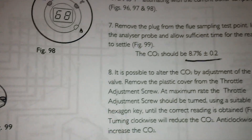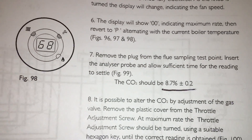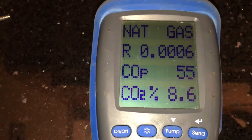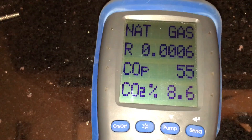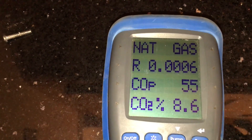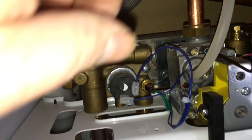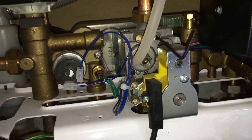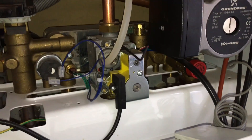So now we're on 8.7. This is as high now, so 8.7 plus or minus 0.2. We've got 8.6 already, so we're not going to mess about that — that's fine. But if we did need to adjust it, then we'd adjust this one. We normally would always have to do this on the first service.